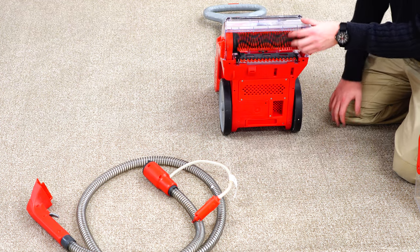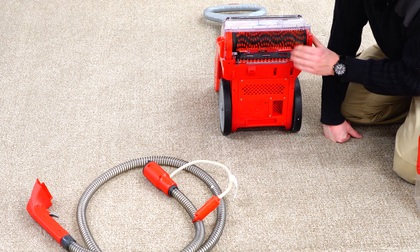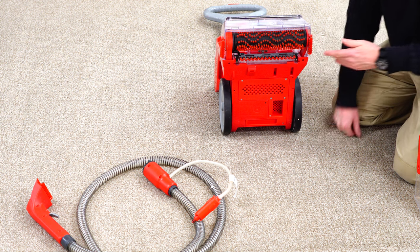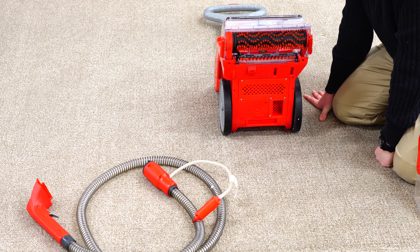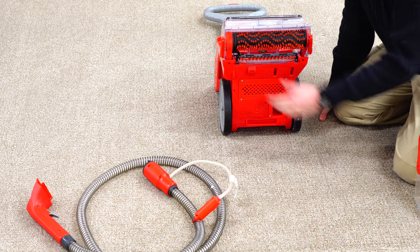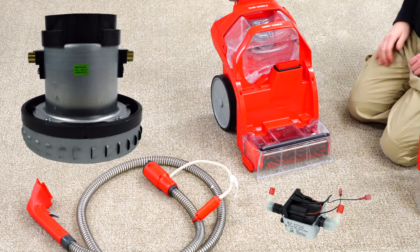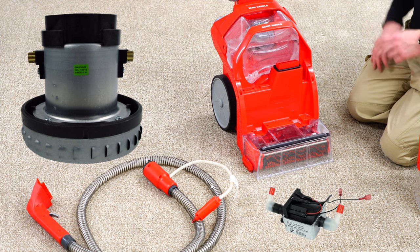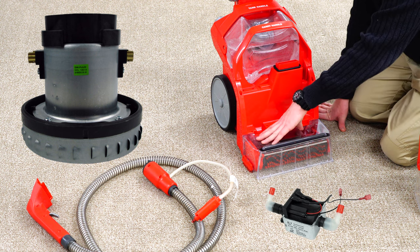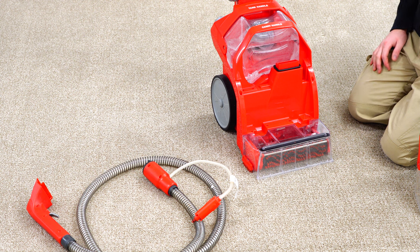Underneath here we have a brush roller — a really thick brush roller. You can kind of have a choo-choo train going on in the rear, which is something Rug Doctor did on their other design. Why they went for a brush roller here seems a little complex to me. This brush roller is driven by its own motor. I did go in here and this does have a solenoid, a pump, a suction motor, one fan, full bypass, and it does have a separate motor for the brush roller. So those are all separate things to be aware of.